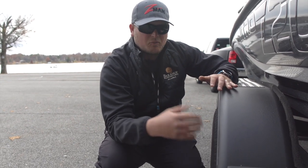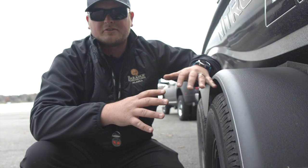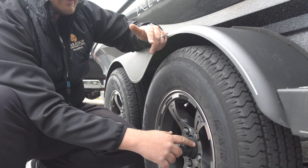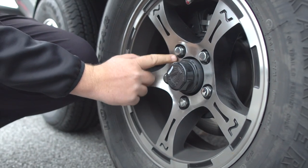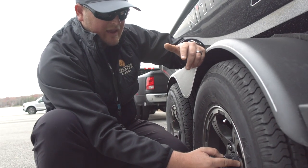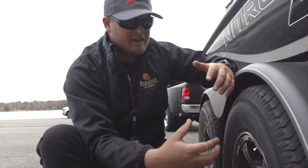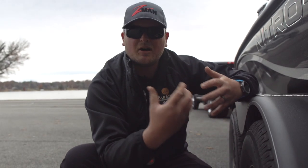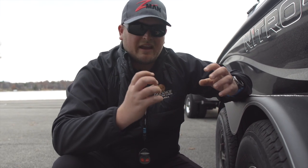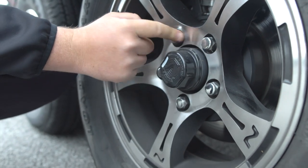Since you're already down here checking the tread on your tires, another thing to look at is your hub again. Check for any grease splattering out of your hub. You're going to have some dust and it'll be fairly dirty, but you shouldn't have any grease spinning from the center of the hub. If you do see a lot of grease, that could denote an issue with a compromised seal in your hub assembly, which is going to allow water intrusion, create excessive heat, and compromise everything. If you see grease spinning out of your hub, that's something you need to address immediately.